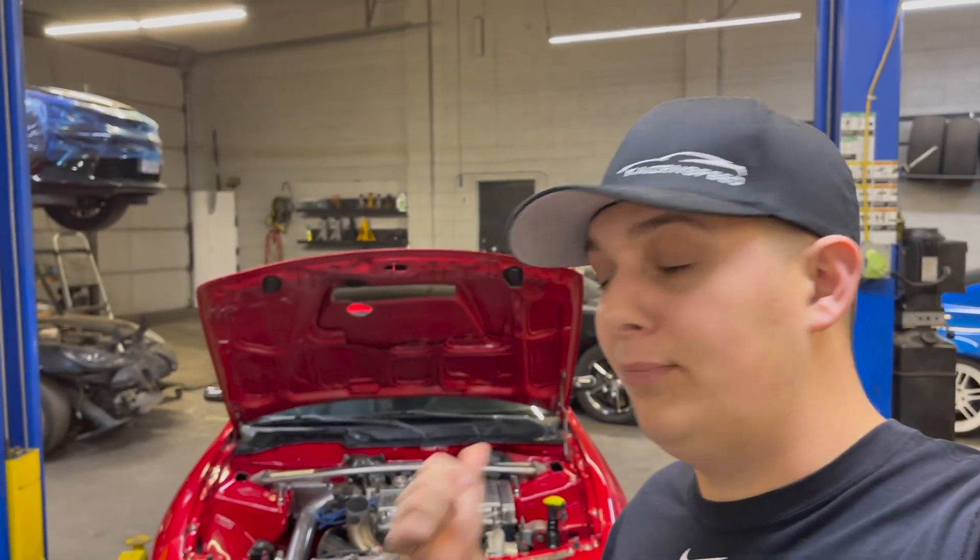The reason why I'm doing methanol injection is for a lot of reasons. It's a supplemental fuel, so that means I don't have to upgrade anything — not my injectors, I'm going to stay with my 1050 ID injectors, not my fuel pump. I'm basically going to leave it how it is. That's the great thing about methanol injection: it is a fuel supply, so you don't have to touch any of your fuel system. It has a chemical compound that, as it gets sprayed and atomizes, it actually brings down the intake air temps an extreme amount. On a hot summer day, boosted cars like this — that makes a lot of difference and could be within a 50 horsepower difference just from bringing the intake air temps down.